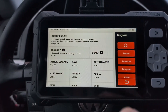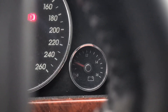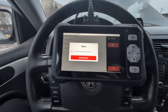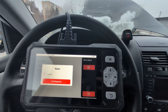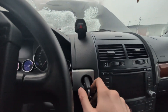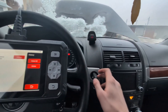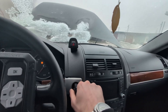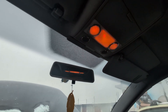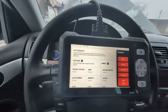Using history for quick entry back to the Volkswagen scan. Battery voltage is still dropping, probably because the engine fan is still running. After the update retry it still has trouble — the voltage is too low. I was hoping the scan tool might turn off the engine fan, but no. The battery is almost completely dead when I try to turn on the ignition. Let's move to another car.